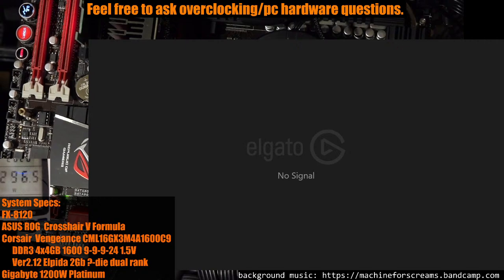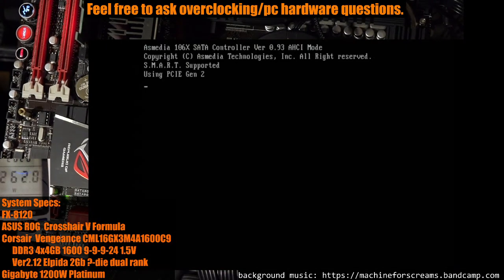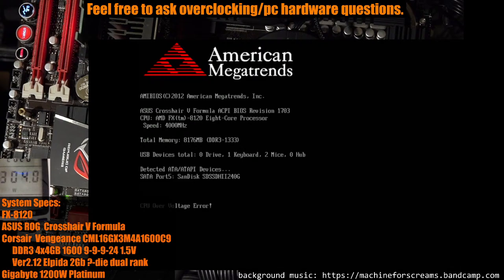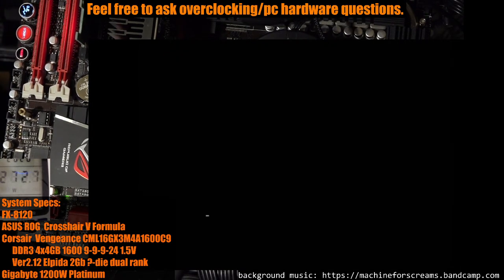This is so much simpler on Gigabyte boards because all of the stuff you need to turn off is in the same menu. So you just go enter, turn off, and then arrow down, right? It's basically a pattern that you can do on the keyboard to disable everything instantly instead of navigating the BIOS to where the stuff is.